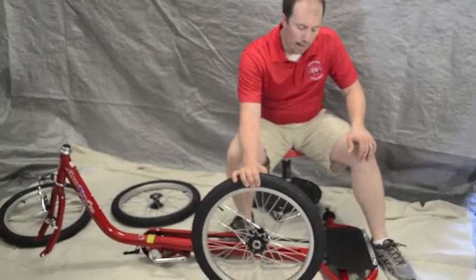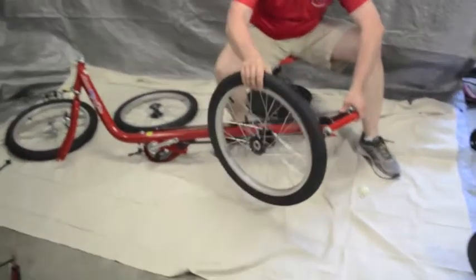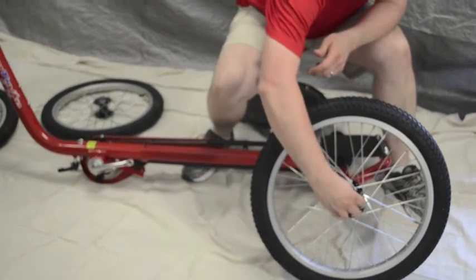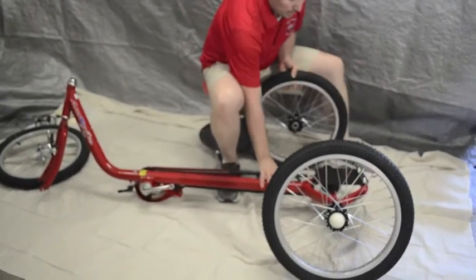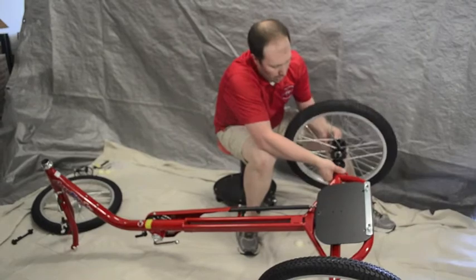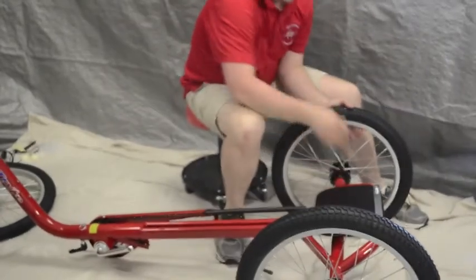To attach a wheel without the rear brake kit, make sure you have the metal spacer and put that onto the axle first. Take your wheel with the arrows pointing forward, slide it on and push it on all the way. Then take your washer, put that on next, and take your wheel nut and cap and turn it just part way — we'll tighten it up in a minute. Then take the other wheel, identical — make sure the arrows are going forward, take off the wheel cap and washer, slide this on. There are three little posts that go into the three holes of the wheel. Reattach the washer and put the wheel cap on just a little ways as well, not all the way, and you're done with the rear wheels.